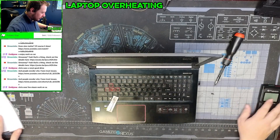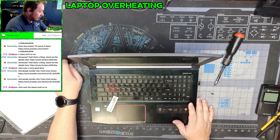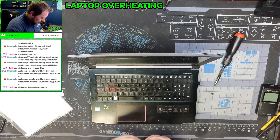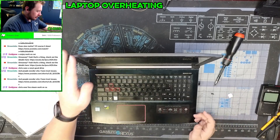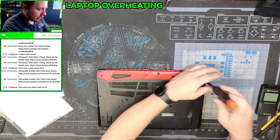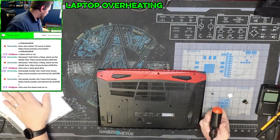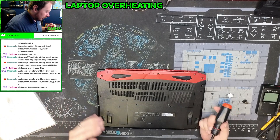A gentleman brought this in having problems with it overheating and running hot. A couple things we've discovered: this button seems to be broken — the clips are actually broken — and you can hear it running very hot. In an effort to combat that, the owner set the fan profiles to a hundred percent to help keep it cooler. This is an Acer Predator PH315-5178.